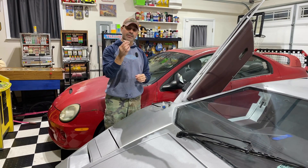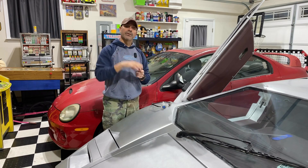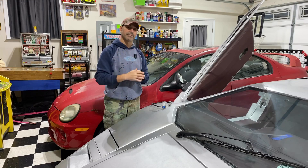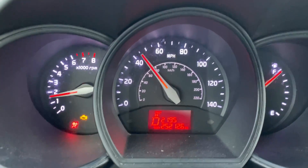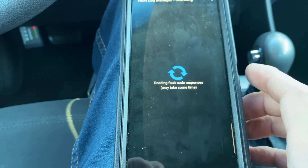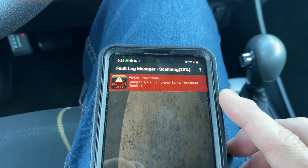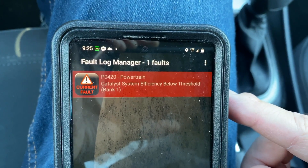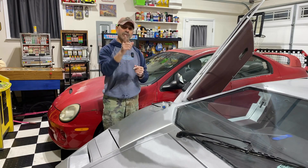Now we're going to take this extender over to the vehicle, install it, and try the vehicle. What I forgot to mention is that the vehicle already failed the inspection. Here's the failure notice from the state inspection here in Delaware. You can see the overall result is a fail, and under the diagnostic trouble codes you can see the P0420. The check engine light is also on. We'll connect it to my scan tool — you can see the P0420 code popped up, catalyst system efficiency below threshold — so we're going to put this on the vehicle and see how it does.